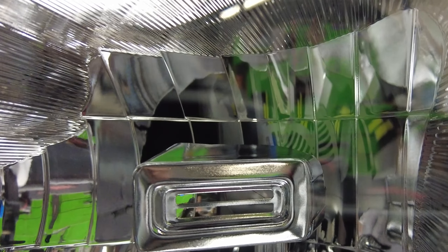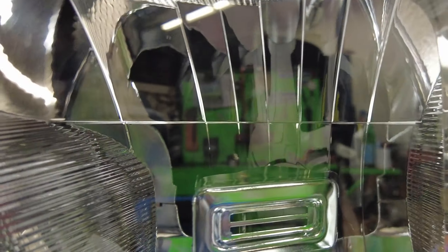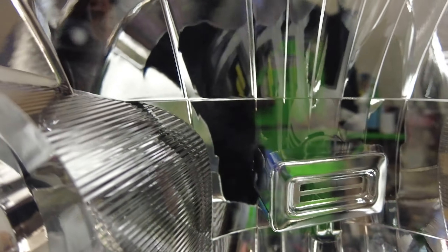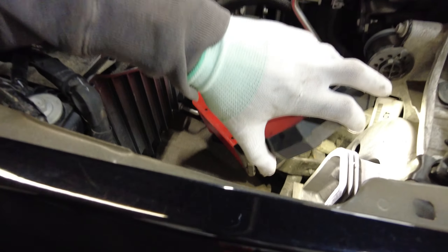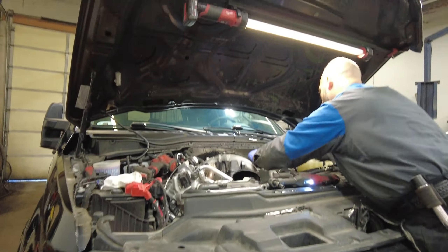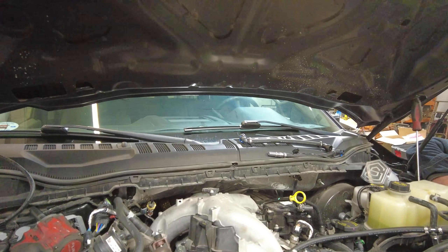You can see the notch and the tab when it's fully seated against the stop, making sure you've actually turned the bulb all the way. When I'm turning the headlight bulb I'm visually looking at the stops from the front lens. I am all done with the headlights — super easy, quick procedure. Thanks a lot to PowerStroke Tech Talk for telling me that trick — that saved a ton of time.